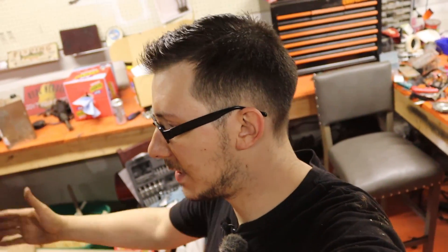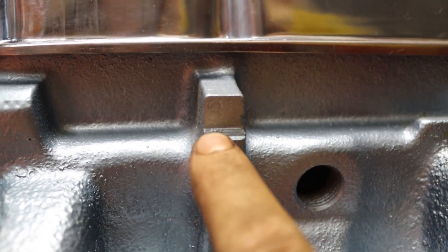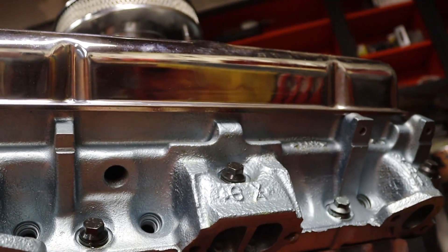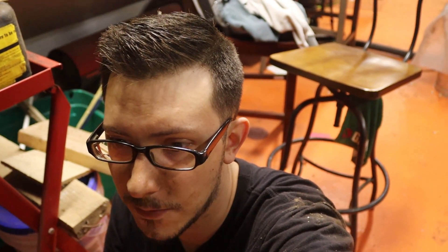That's where we have the 6X heads on the 75 — 8 heads. Looking at the bottom of the head, there's a number — number 8. This tells me this is the large combustion chamber 6X heads. The Firebird has the small ones — these ones are like 102cc, and the Firebird ones are like 90-92cc. For a larger cube engine these heads would be just fine — like a 455 or 461. But on something like the 400, it puts compression down to like 8-to-1, which is totally safe with pump gas.